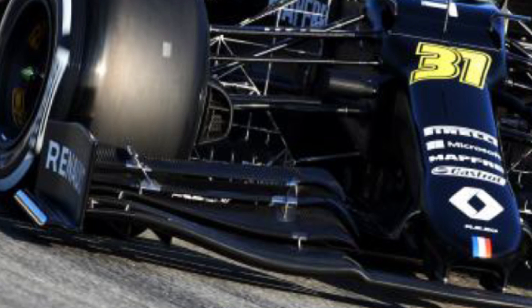It comes to a nice round point, making Renault another team to bring out a different concept of nose cone to what we've seen from them in the past. Also if you look at the edges you can see this little scoop that comes out. I can't quite see where this scoop goes — the downside of having this black livery is you can't really see in too much detail where the aerodynamic components are going. I've got two theories: either it pushes air outwards towards the barge board section and maybe into the suspension, or it pushes air inwards towards the front of the floor or possibly into an S-duct. We can see that Renault have got an S-duct — just above the number 31 there's that little slot in the nose cone structure.